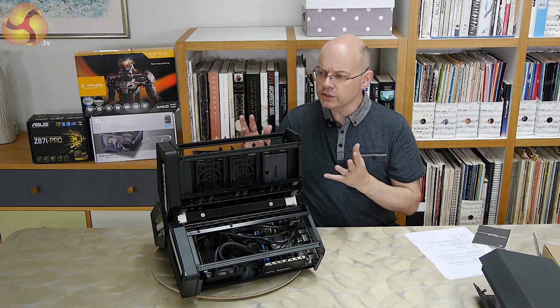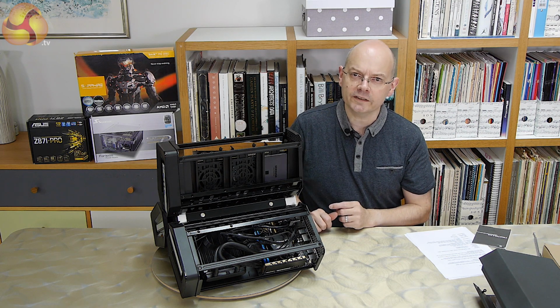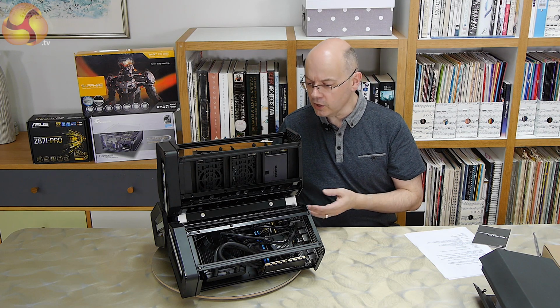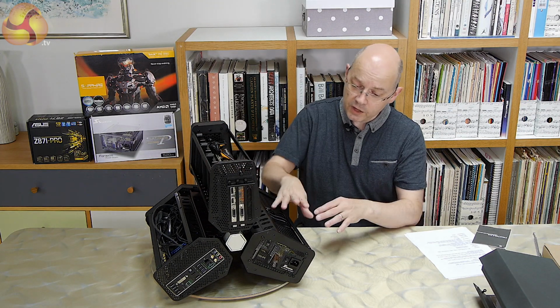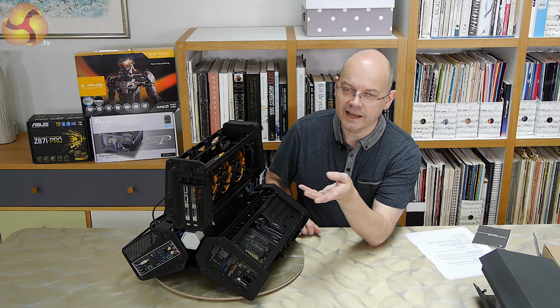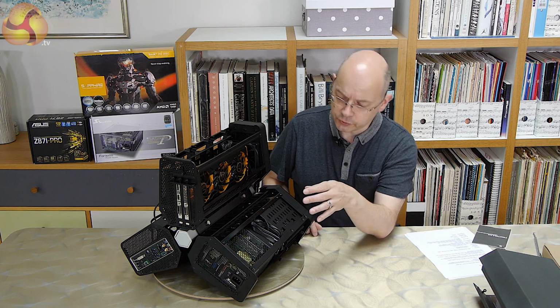So building the PC, not especially difficult. Although many small form factors can be quite fiddly, and there is a degree of fiddle with this, it all works pretty well. You have to put your power supply in first. I've gone for a Seasonic 520 watt platinum fanless, which is there. It's a conventional modular ATX, except it doesn't have a fan in it. Other than that, in terms of size and function, it's dead conventional.